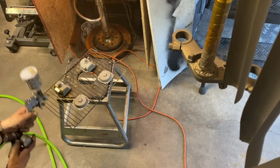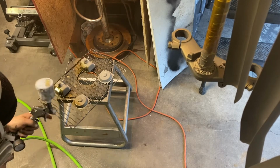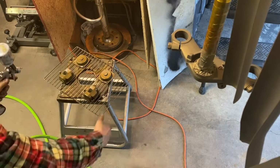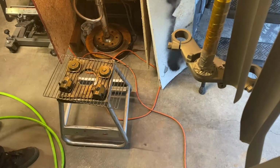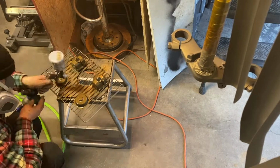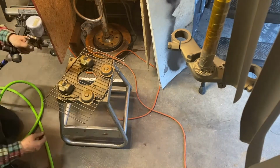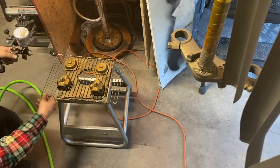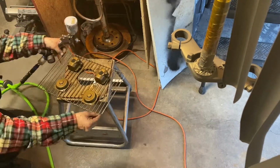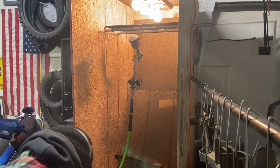Obviously the inside of these does not have to be coated, and we didn't really want any coating on the gasket surfaces or anything like that, so I taped off the bottoms with some high heat tape. Then I went about ceramic coating these. We used the same burnt bronze color at the same 18:1 ratio as always. The idea behind that is that the components on this bike will match the components on the other Suzuki, and even though I'm coating this bike at separate times, everything should match pretty well.